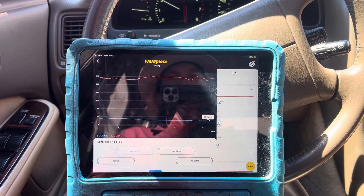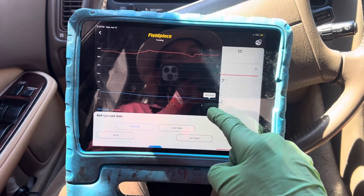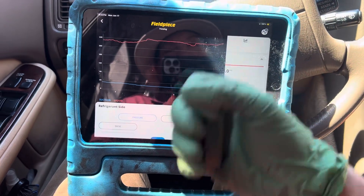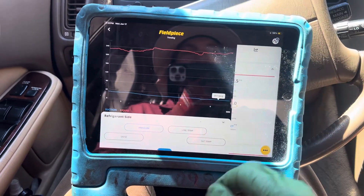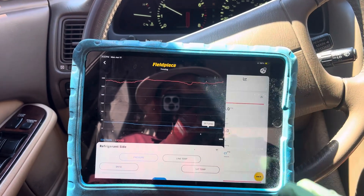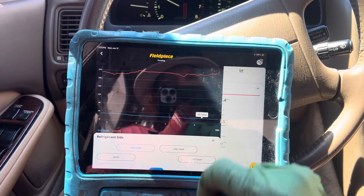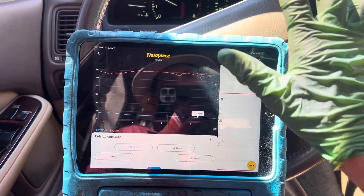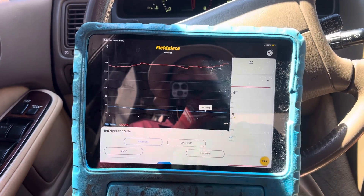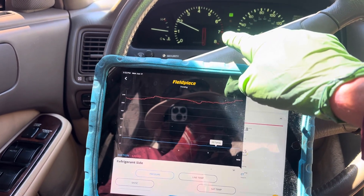Still 20 psi! The AC Pro whack-off can thing with the little blue spot says it's low — I've got to add more refrigerant. Let's keep adding refrigerant. Of course you can't see the high side because you're using the whack-off cans of AC Pro. We're still at 2,000 RPMs and our high side is going up. Remember, there's a thermal fan clutch on here and two electric fans, so we'll have some interesting behavior as that thermal fan clutch goes in and out of operation and fan speeds go from medium to high.